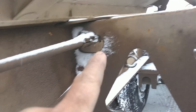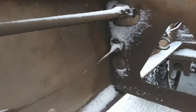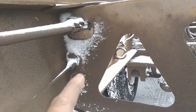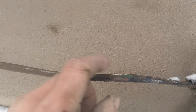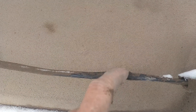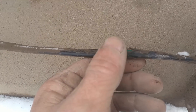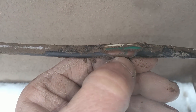I've been all up and down the wiring, everywhere that it runs, all the way from where the junction is back here to where it runs back forward. I found a few maybe things, but nothing that actually fixed the problem. Then I get up here — you see this spot — the outer sheathing on this wire broke out, but the wire doesn't look damaged at all. But I noticed that the brown wire here, which is the one that feeds the marker light circuit, looks kind of swollen up.